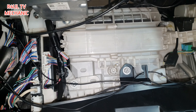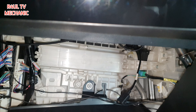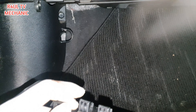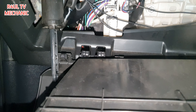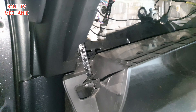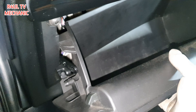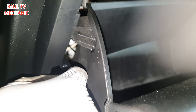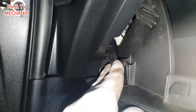The cabin filter is in there, the cover's back on — dead easy. The way you took it off is exactly the same way you put it back on. Now we're going to get the glove box back on. The locator for the glove box — the little hooks there — goes onto them, them two there. You can't really miss it, can't really get it wrong. Get them lined up, same on that side, and just give it a little push and it should go straight on. Then manoeuvre this part — don't go jamming this up — lift it up, go past the step here, and then put the damper back on. Go to this side here, can't really go wrong — boom there we go, happy days, job done.